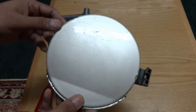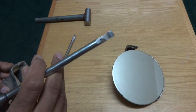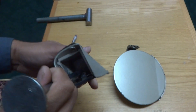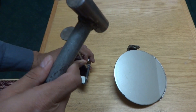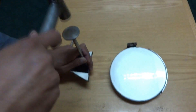The breaking parts had been broken from this location and from this location. So what we will have to do is we will rebuild up to here and the same way up to here, and then we will make a through hole over here in this location. We will put some fulcrum inside and make the same hinges effect as it was. For this purpose, we have to remove this old plastic material from the inside.